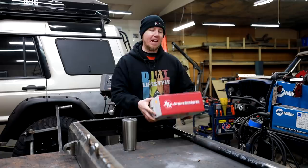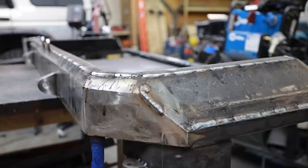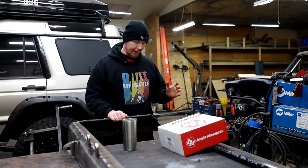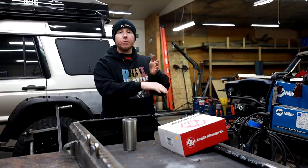This was a late night — I finished up this bumper last night, so the fabrication on this is essentially done. I added a lower rim that went all the way around the bottom part of the bumper and I highly recommend this. It adds weight, but the benefits are gigantic. I've built bumpers without a lower rim and with one, and I can tell you that rocks like to grab an edge that comes straight down. But if you have something smooth on the bottom side, rocks are much more likely to hit and then bounce or slide off.